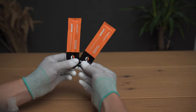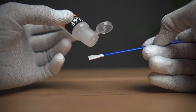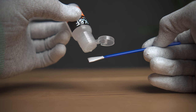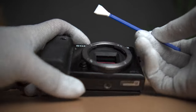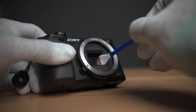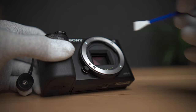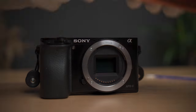You need to use two swabs: one wet and one dry. Take your cleaning fluid that comes with your kit and put just one drop on one swab — one drop is enough, don't put too much liquid, otherwise the sensor will be too wet and you can get stains. Then simply go from one side to the other, gently but firmly. Don't be afraid of breaking the sensor — you can't really break it. Don't put all your force in, but also don't be too timid. These sensor swabs are quite elastic and soft, so they can't really damage the sensor if you don't do anything crazy.